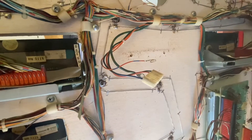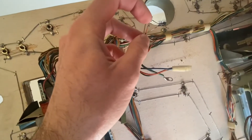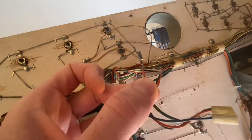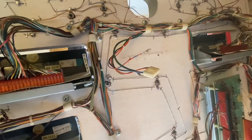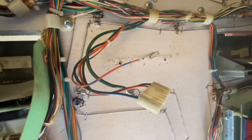This should last a long time as long as you don't expose your machine to bad weather where it could corrode — which is kind of the issue here, there was oxidization or dirt. The pin's just dirty. You could scrape it with a paper clip while it's still in the Molex connector, or try a pick, but the real best way to do it is to pull it out and put on new pins.